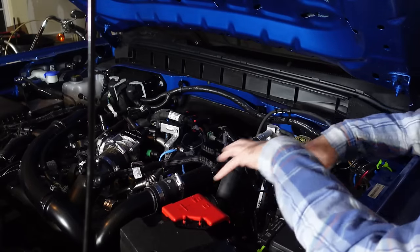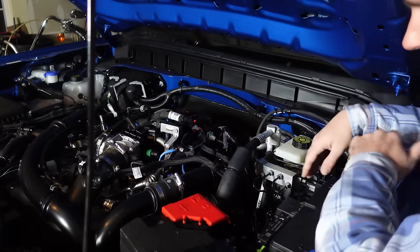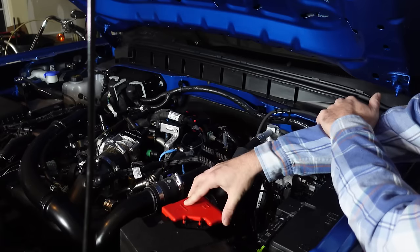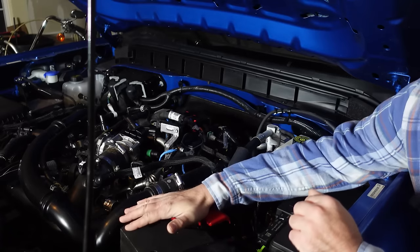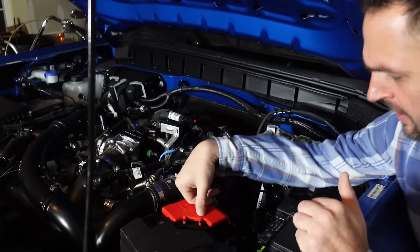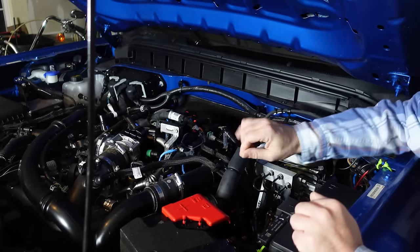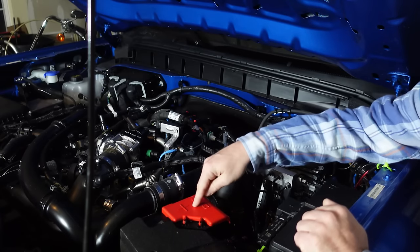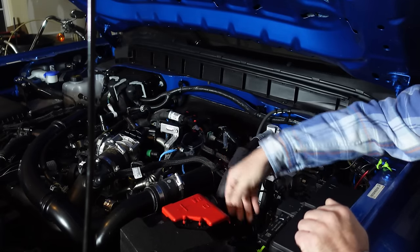More importantly, this tubing helps make sure the wires don't hit anything too hot or short anything out. I think that this tubing is a wonderful idea. One thing I want to do differently in the future — and I think it's very important — is you should have a fuse as close to the battery as possible. If anything shorts out, you short out there instead of all the way down the wire inside the vehicle, protecting against anything negative happening. In the future, I will fuse the battery wires right at the battery.